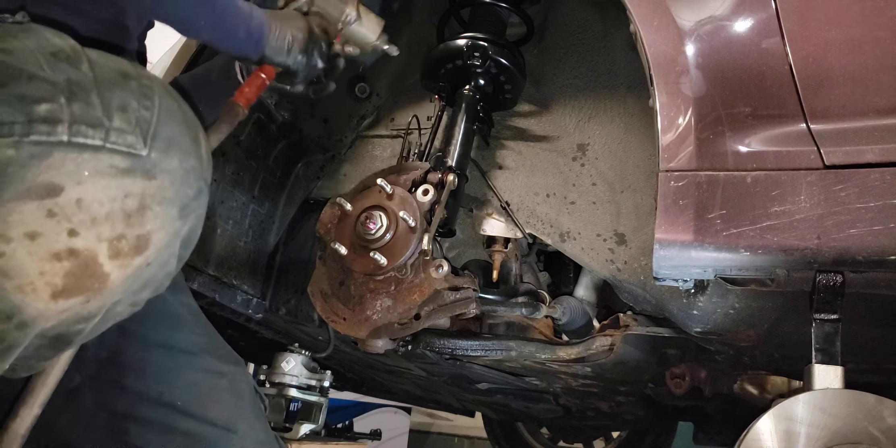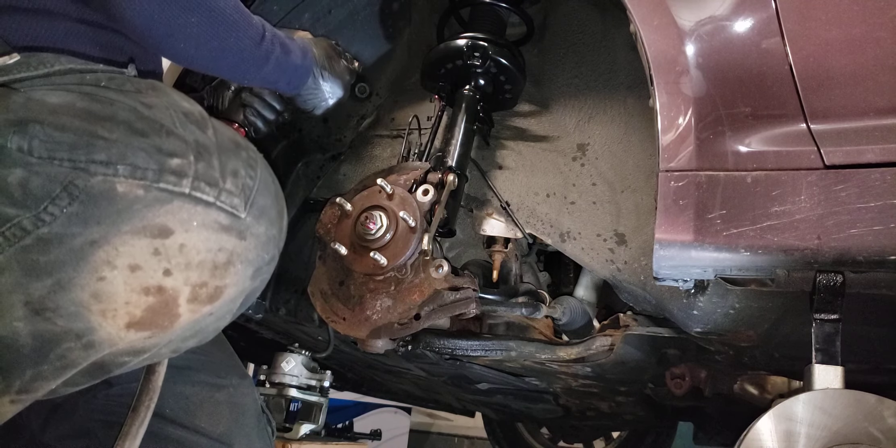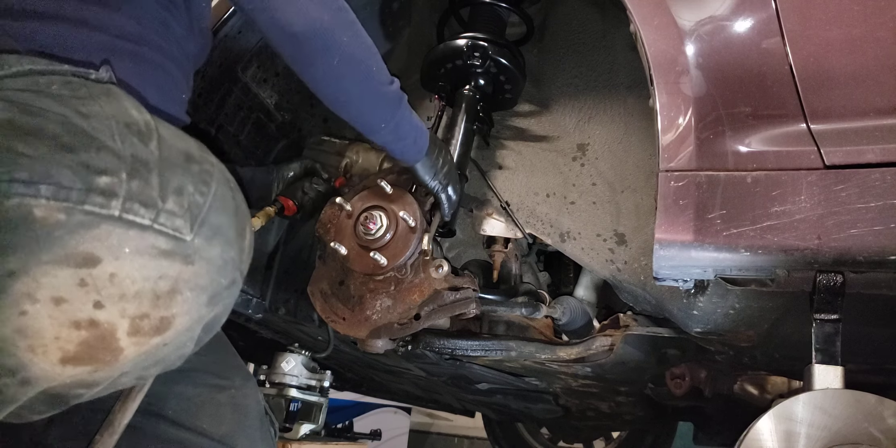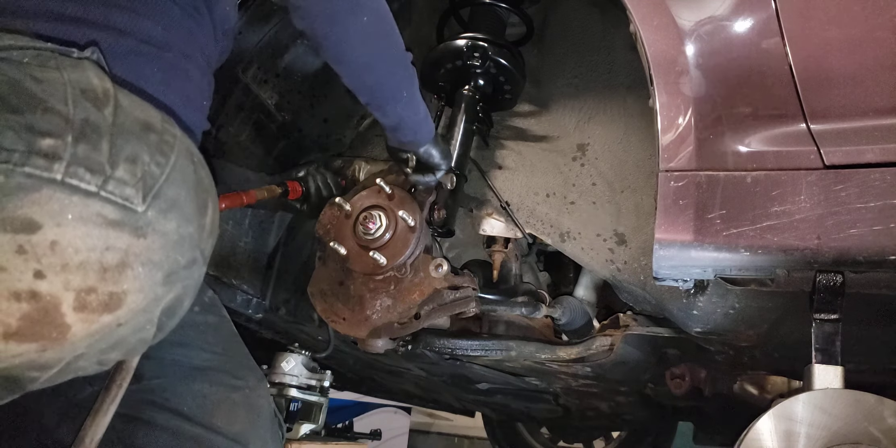Most people won't have the equipment to do alignments, so just keep that in mind. Most of these you can just bolt them right into place — a lot of them have slots. This one did not, but it has enough wiggle room that there will be a camber adjustment here. I've got the bottom one kind of snug and the top one loose, and once I get where I'm supposed to be according to the marks on the other strut housing, I'll snug it down and tighten them all. 2011 Kia Optima LX 2.4 liter — February 15th, 2020. Thanks for watching.